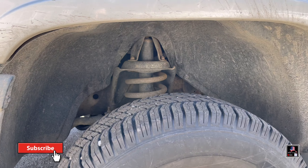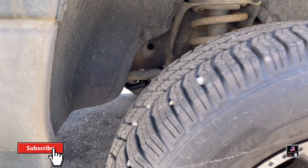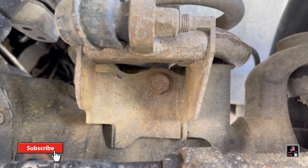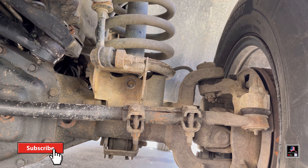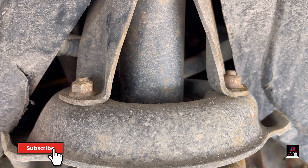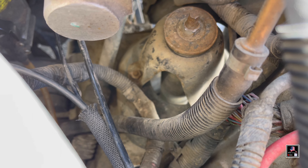Driver's side front shock — the measurement is 38 and three quarters inches. We're going to start by taking a 21 millimeter to the bolt right there. There's another bolt on the side which has a key that holds it in place, so you just use your impact to take it off. Once you get that bolt out you'll hear the nut fall off in the back. Then come up top where there are three 15 millimeter nuts — two right here and one on the other side in the engine compartment.